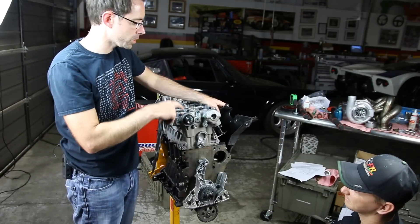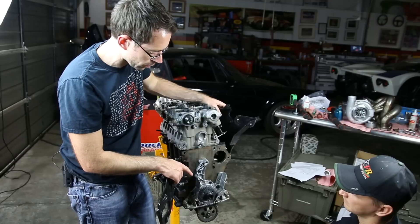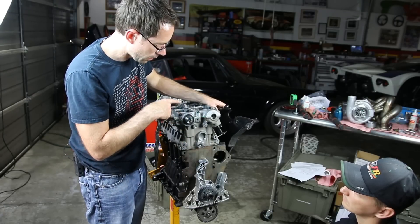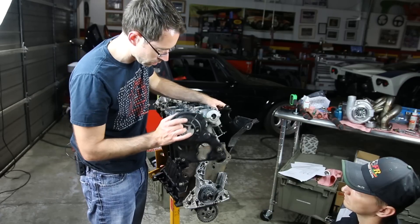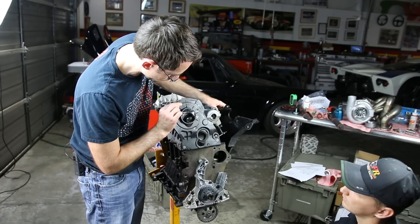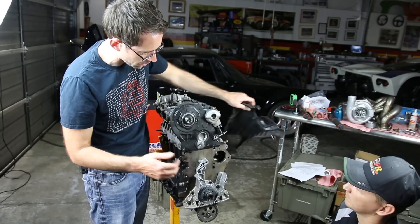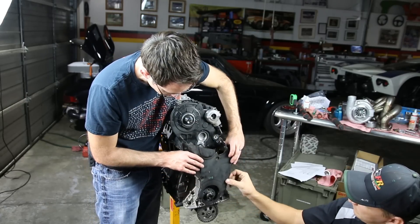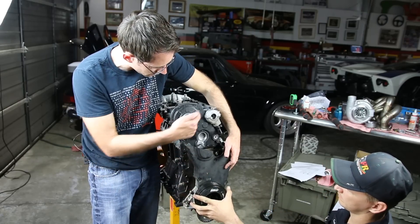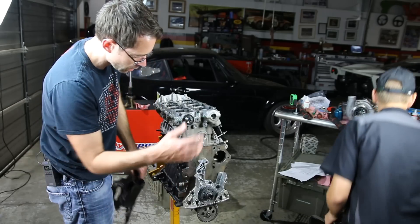Now our top end of our engine is all bolted on. The cam cradle is all torqued down, and we went ahead and double-checked the timing of our engine. We did so because we're not going to be running the upper or lower covers on this car, mostly for aesthetics because the integrated valve cover is a little bit different. We mounted our cover in place and checked with our timing mark there, then mounted our lower cover in place, swapped our lower pulley on, and you can see that our timing marks line up there. So we're all timed up and ready to install the rest of our timing parts.